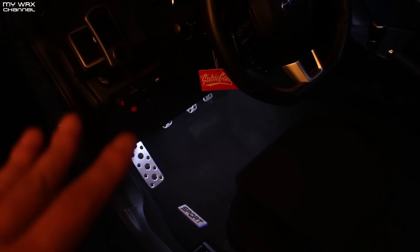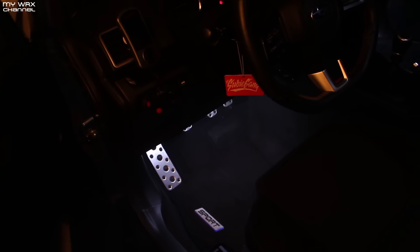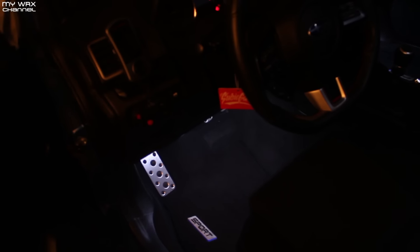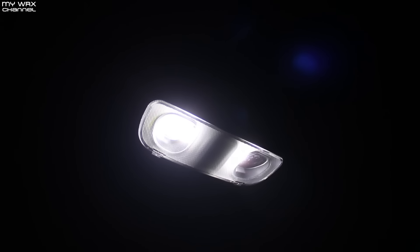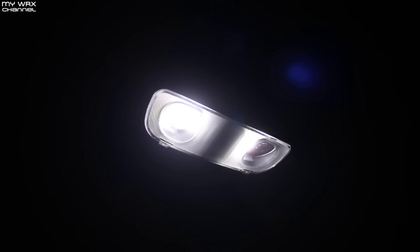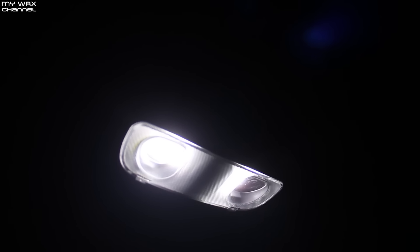One thing I like about this — I don't want these on all the time when I'm driving, I just think that's super annoying. They fade out when you close the door or lock, and they turn on when you open the door or unlock your car. Exactly how I wanted them. Really easy to do — if you just wire them to the map light they'll function that way, giving a nice clean stealthy look. I just wanted a plain white, nice clean looking light. Ninja Bart mapped his up to the map lights, but that doesn't work when you turn on the car because I have a cheap base model, so I had to wire them to the dome light so that they fade in and out when you lock and unlock the car. Pretty much the same concept, just a different power source.